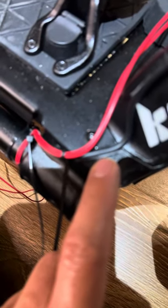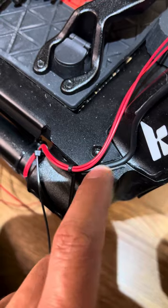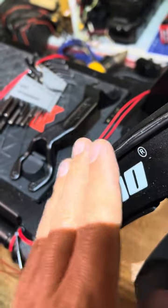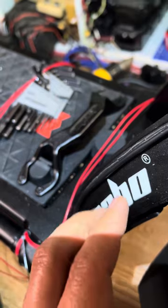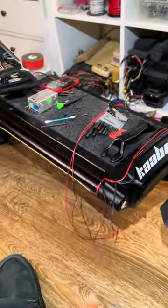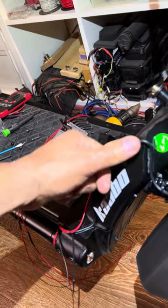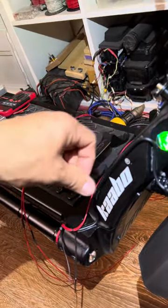As you can see here, I did it here — there's some there. I just clean the wire and clean the paint with rubbing alcohol and it stays. See this wire? It has no zip ties on it and it just stays there. If it unsticks, it's just because I didn't clean the wire enough. I've run wires like this on scooters for many, many years and they never come off. And when I do take them off, they really stick well — you just rub the wire to get the double-sided sticky tape off and it rolls right off.